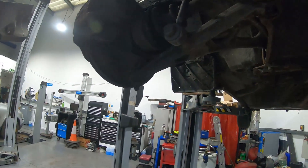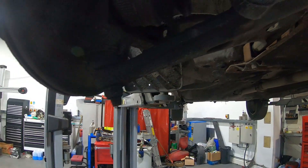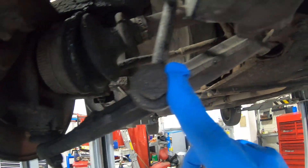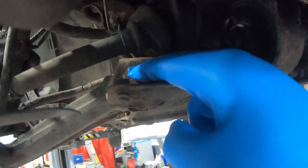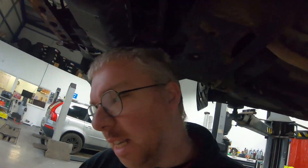I'm going to start cracking on with that and take you along for the ride. First thing is to undo the arm itself. At the bottom I think is a 19mm, same here - this bolt goes to the suspension arm, this one is for the drop link, then this bolt on the front of the suspension arm, and then two bolts for this bracket - one nut and a bolt for the bracket that loosens the entire arm. Then we'll look at lowering the subframe. I'm hoping to just lower it rather than take it all out. I have replaced that bush before, and to save money I didn't do that one at the same time, which was a bit silly.